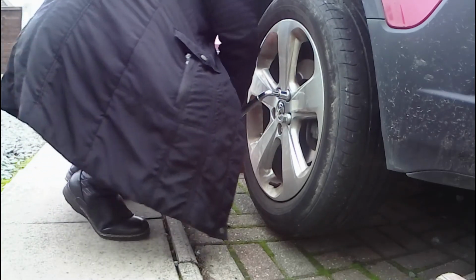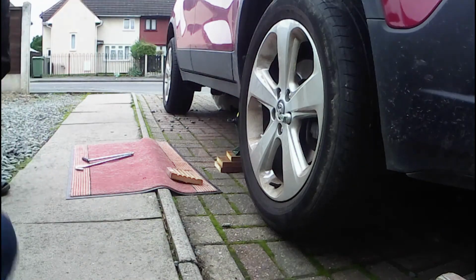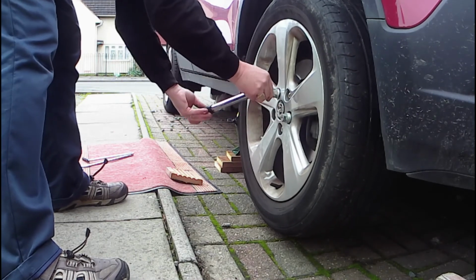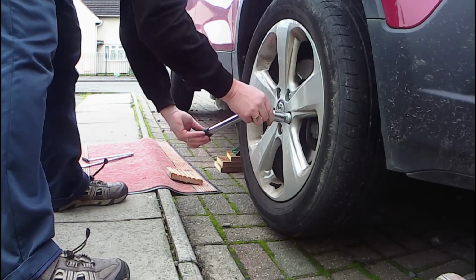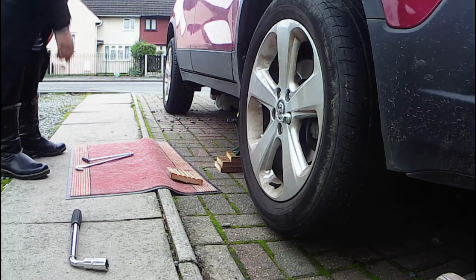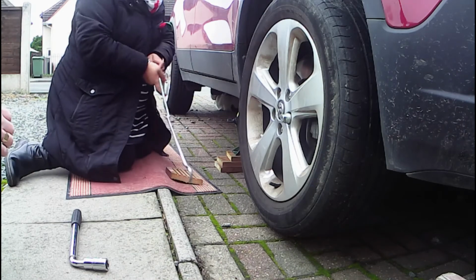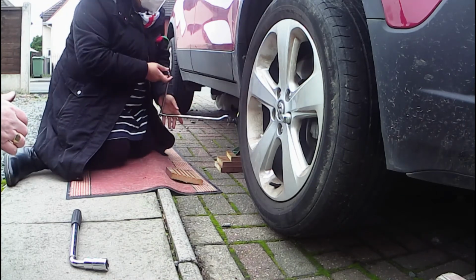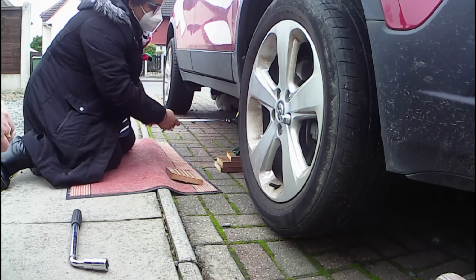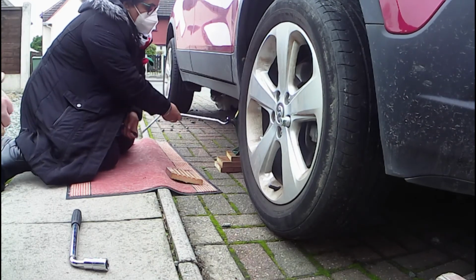If they're fairly snug, that's good enough for now. Absolutely fine. So now we lower the jack down so that the wheel goes back on the ground. This goes left. Lefty loosey, that's right. It's much easier taking it down than going up, because the weight is helping press it down, you're not fighting against gravity this way.